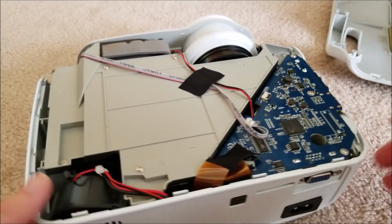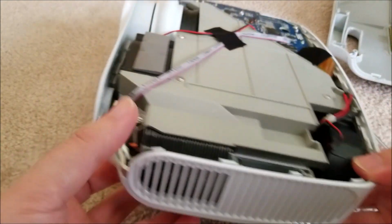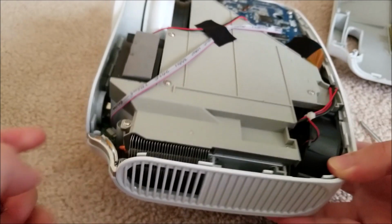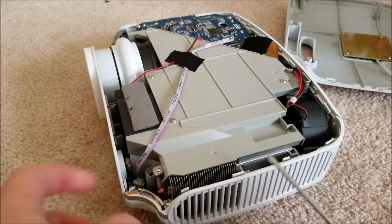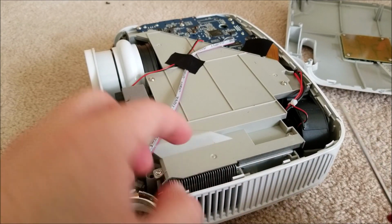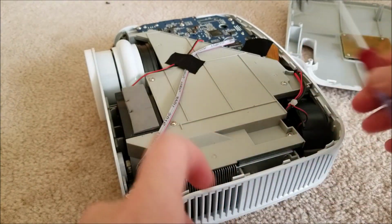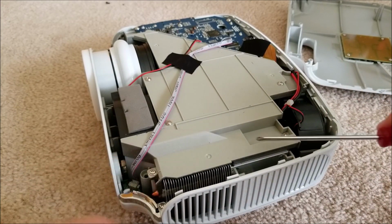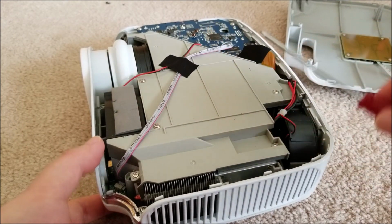I really like that. We have the fan here, actually thermally designed. This is very well designed. There's another fan here. It actually blows the air out the venting on the side, and so basically you have the heatsink. I'm guessing the LED is going to be somewhere here or maybe up here. Probably, actually, if I think about it, up here. There are heat pipes going over, and probably the metal mounting pad is here. The LED fires this way, I'm guessing.